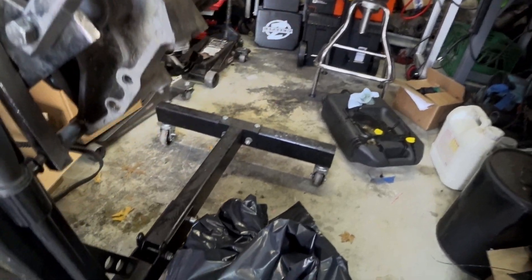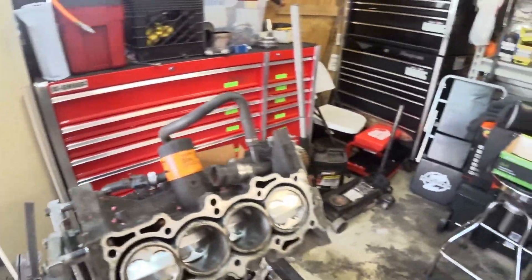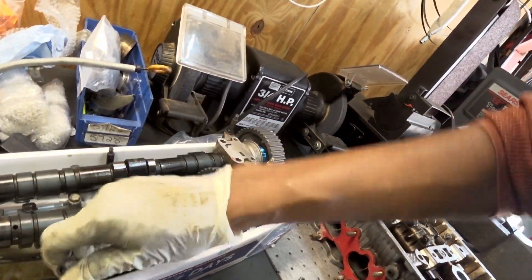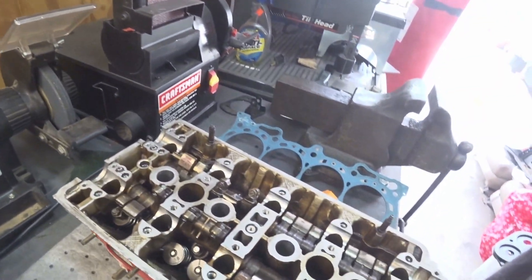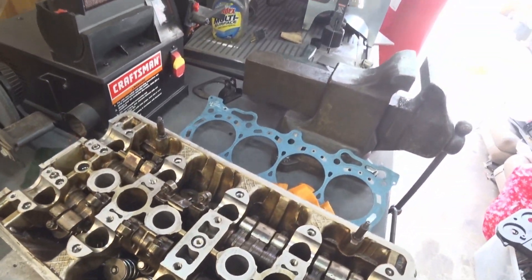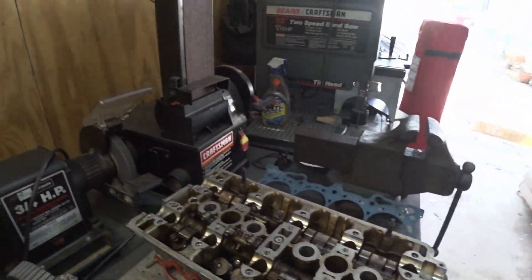It's dirty overall, so I'm gonna take the pistons out, make sure everything inside is good. Once that's all worked out, we'll start focusing on the head. It came with ARP head studs — I'm about to put those back in the bag, keep them safe. There are washers in here, and it has valve springs but stock retainers, so I may upgrade to titanium retainers once I figure out exactly what the setup is. It's basically a semi-built head and a built bottom end, so we're gonna dig into it.